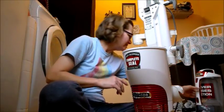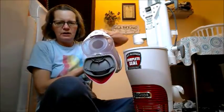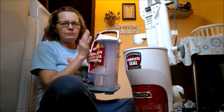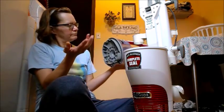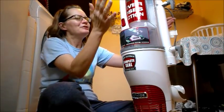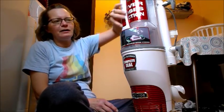We've gotten our sponges in. The next thing we want to do is get this little filter here. You will pop this top part out - you see that little hole right in there? Just put it in there. You want to make sure it's in there good and solid so that you have a good closure on this, because if that little round filter is not put in there all the way, you can't get a good closure and you risk the chance of hurting your clip or whatever. You just clip your canister back into place, because if you use your vacuum you've got to take this off from the button at the top and then release your dirt.